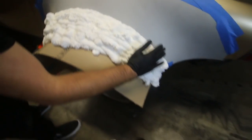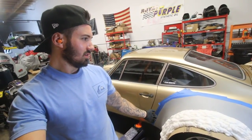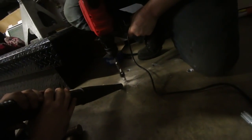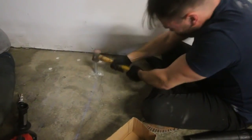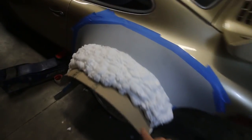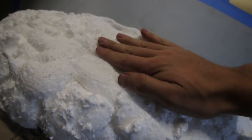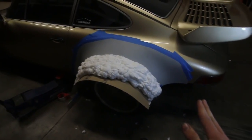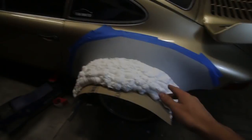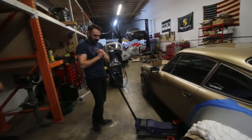We may have made a mistake - it's not really sticking to the flare. So we've got to wait for the foam to dry, and we're going to go over and install our second set of jacks in the meantime. What we're hoping is that it's going to cure all the way, because right now it's like a medium rare steak - firm on the outside but the inside is definitely still liquid. It says it's sandable and paintable, so we'll be able to do some cutting and sanding, shape it, and then that'll be our rough outline for our mold, and then via the mold we can make a carbon fiber flare in a perfect world.